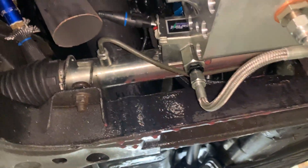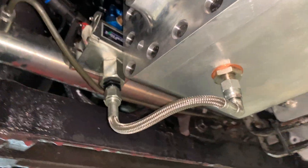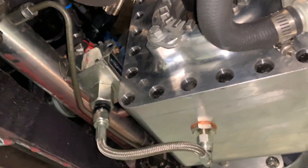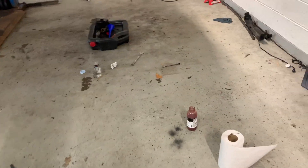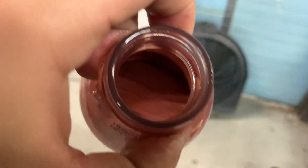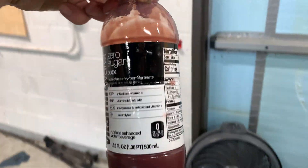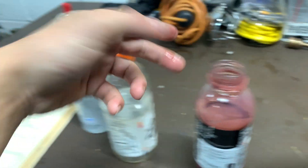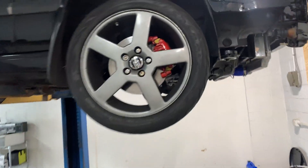We've got to start actively working on getting some of these leaks under control. I've been doing so many pulls, but now that we know the all-wheel drive is working, we can address this. I got the fluid drained — there was only about three-quarters of what I originally put in because the pump came off twice. But there's no metal in it. It's starting to get a little dark, going from bright red to more of a cranberry color, but no massive metal particles, so everything should be fine in the angle gear.